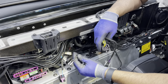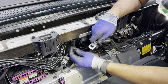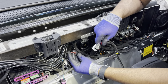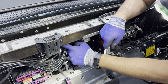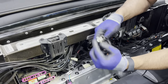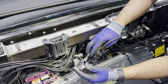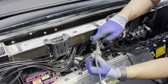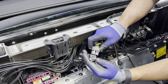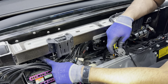We've got to disconnect a few things here. Starting off, we've got the hall sensors — you can see the plug here with red and black wires, it connects in there and is clipped in on the top with this clip. Then you've got the wiring for the demister — I've already taken the pins out of this plug here, which connects in there and is clipped in just at the back. I've had to disconnect a couple of cable ties just to get access.